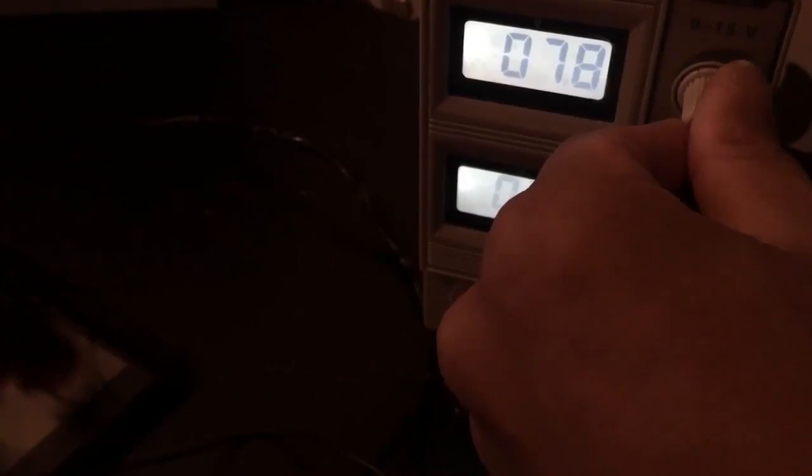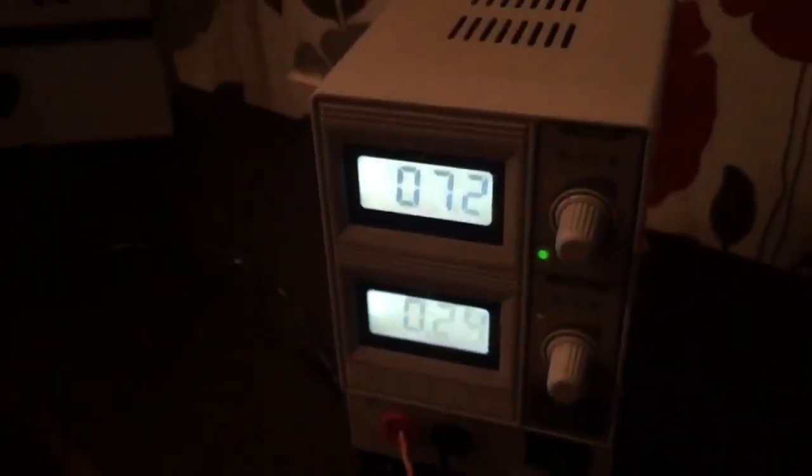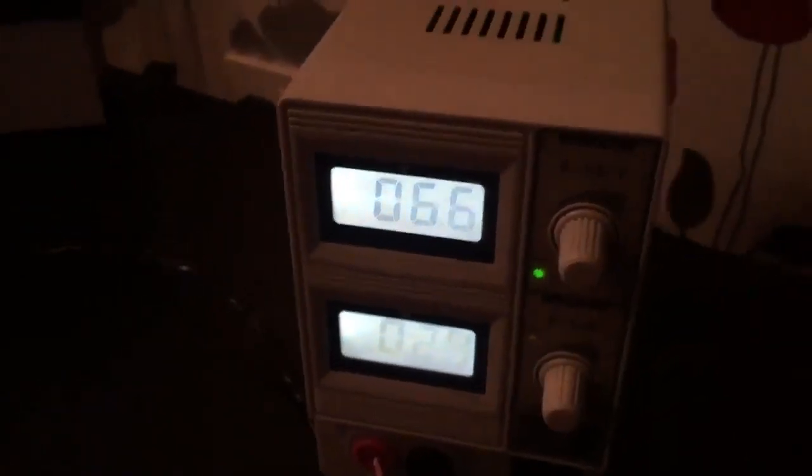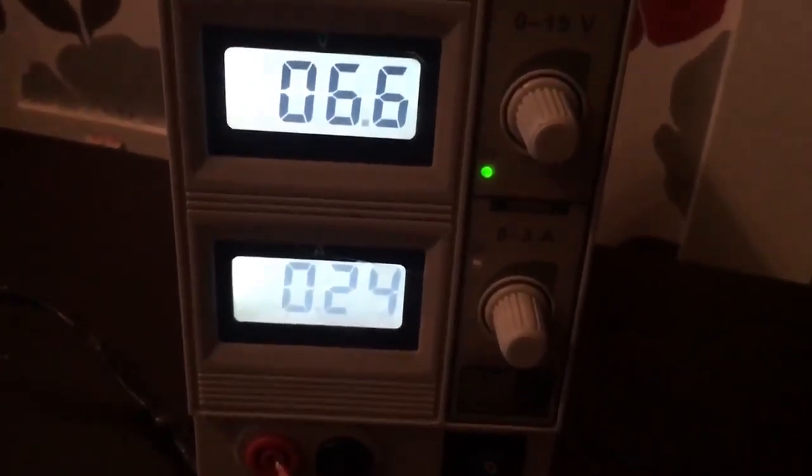Which is quite simple, as you see. So in the next step I'm going to show you how to connect it to basically any car. As you can see it's using 11.9 volts, however I can lower this to about 7.2 volts and I still have a monitor. I can lower the amp a little bit and from here it gets fuzzy — that's 5.9 volts. So around 6.6 volts it works. Basically this monitor and the lights work on 6.6 volts with 0.24 amps.